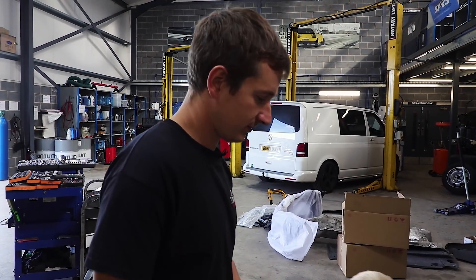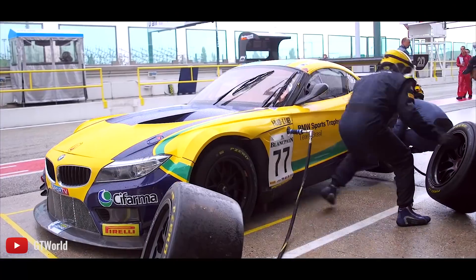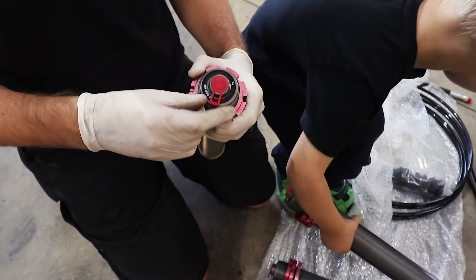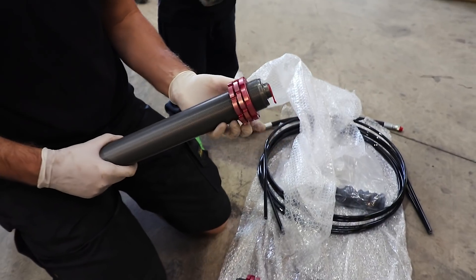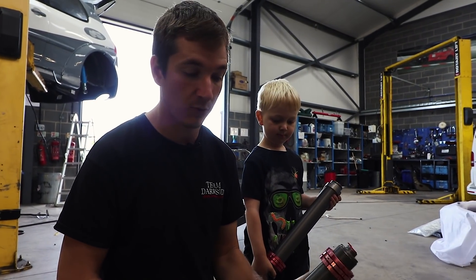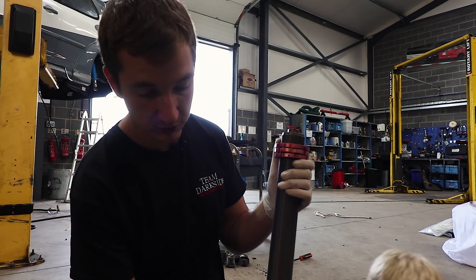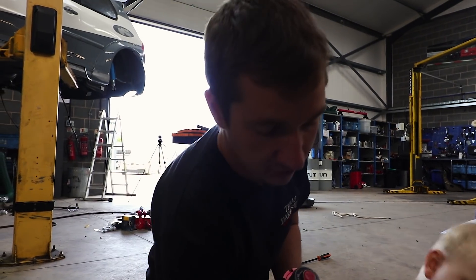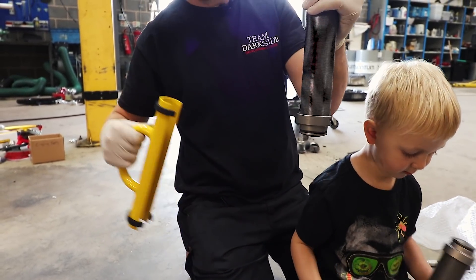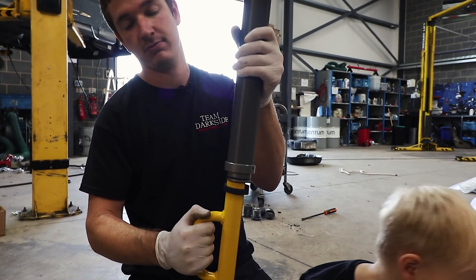Another thing that's just turned up is some air jacks. We'll put a video up of these in action. We've got these from JLS Motorsport - you can get them from AP Racing and places like that but they're a little bit more expensive. Not sure why these are pink, I'd have thought they'd be red. These are the same ones that are in the Leon - the reason we went for these is the same stroke, so we can use the same locks. What these are: they're like an axle stand - when you jack the car up, that pushes the car up and you stick the lock in there as a safety device, so if the air disappears you're not going to get dropped on.